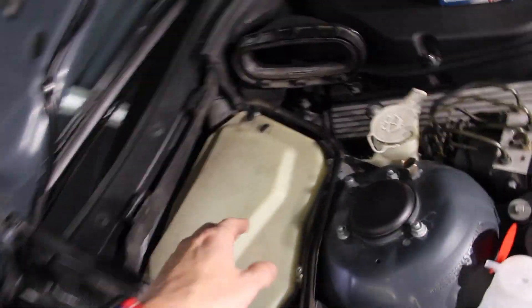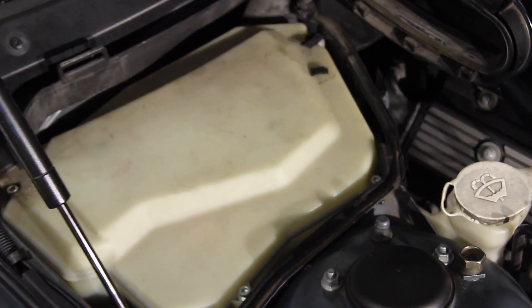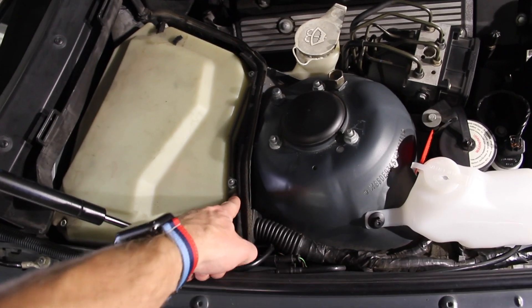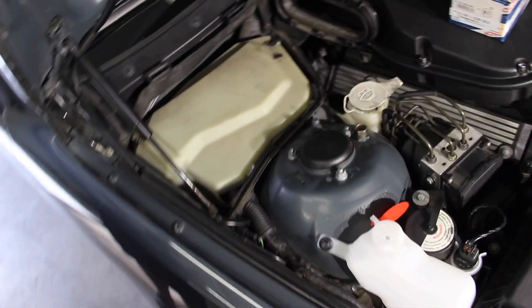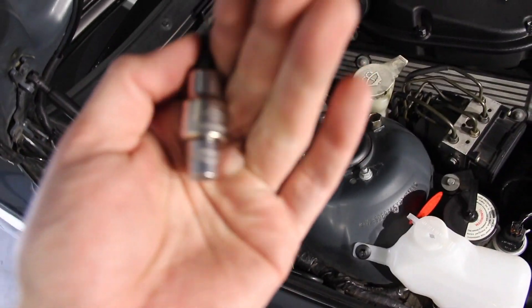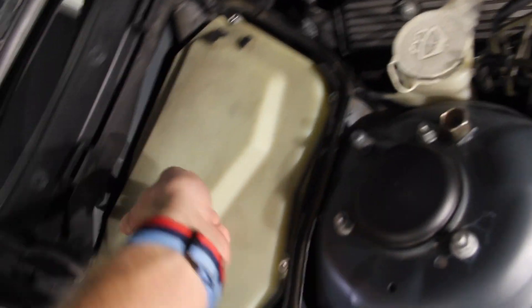This reveals the DME box, which is held in with four allen screws — they are 5mm allen bolts. Be careful with these: the box itself is plastic, and the corners on the back and side are really sharp — it will cut your hands. The lid and body of the box are plastic with metal rivets that have threads for the screws. If they stick, they just strip. The best way to handle a stripped screw is to put it on a gun and buzz it out — the plastic melts, it comes out, then you can re-glue it. We remove a total of four screws.